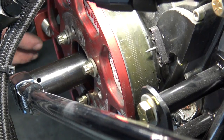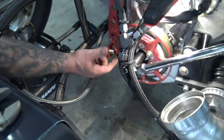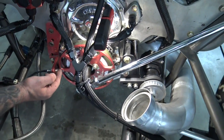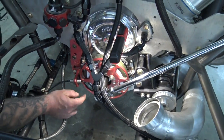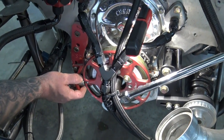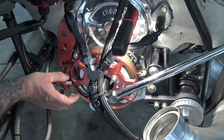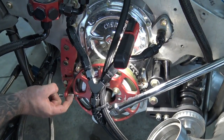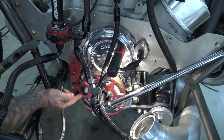The rising edge is the leading edge. The magnet comes around, hits 60 degrees right at the front corner of the sensor. The falling edge would be on the back corner of the sensor. I like to set them up on the falling edge. Rising is: the sensor sees nothing, then out of nowhere there's the magnet — now we see it. The falling edge is: we see nothing, then we see the magnet, then we lose the magnet. That's the falling edge.